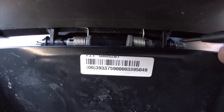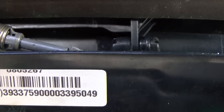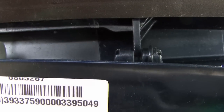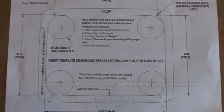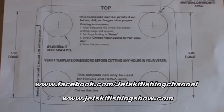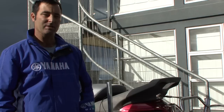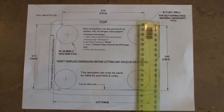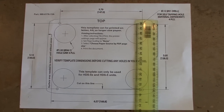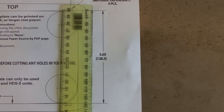Next, take the lid off the little storage compartment just up the front of the jet ski. You take it off by depressing the pins and popping them out — they slide straight out and the hatch will lift straight off. Once you've got it off, you can lay the template over the top of it. You can download this template from our website or Facebook page — cut the centre part out, stick it on the hatch and mark it out with a felt tip pen. If you're using this template, once printed out, check very carefully that it's printed to scale. Check the dimension that says 128.3mm — when you put your ruler on that measurement, it should read 128mm. If it doesn't measure that, do not use the template.